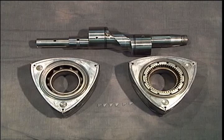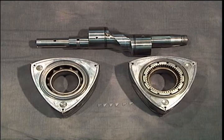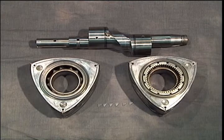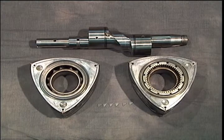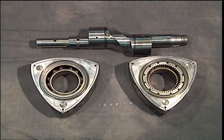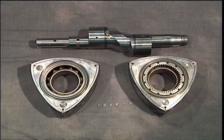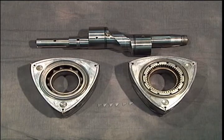Make sure the shaft does not have any scratches in the bearing areas. Polish the bearing surfaces with a Scotch-Brite pad by hand. Be sure to blow out any dust or debris that may be in the shaft. Discard the shaft if it has ever experienced a bearing failure. A bluish discoloration is normal due to the original equipment manufacturing heat treating process.